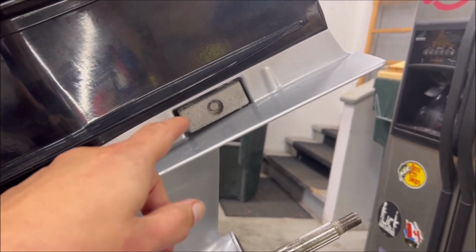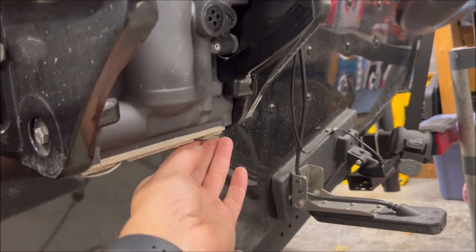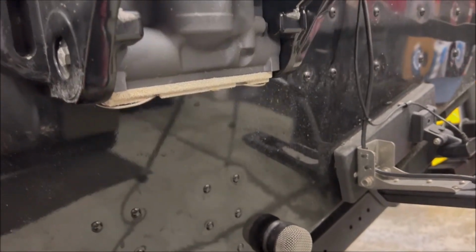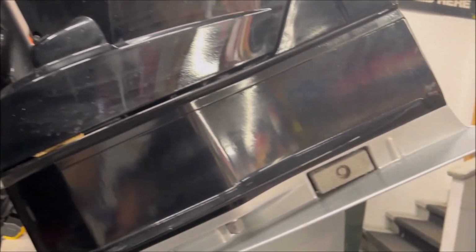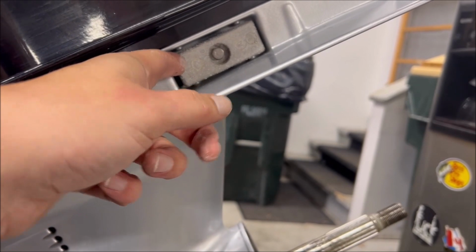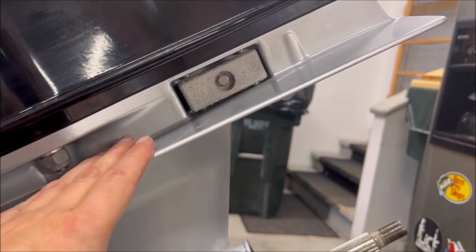There's one here, there's one on the exact opposite side that cover the motor. And even though this is really up here under the hydraulics, down here there's a big one that covers the boat. So this is only the end of the second season here, so my anodes are in pretty good shape still. I should get a lot of years out of these, but if you see these getting worn away, or really flaking off pretty good, replace these, because again, it'll eat away at these instead of your hull and your motor.